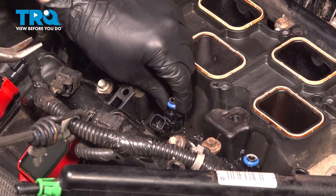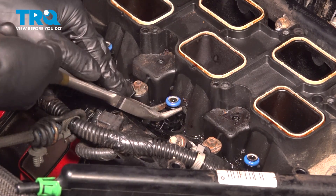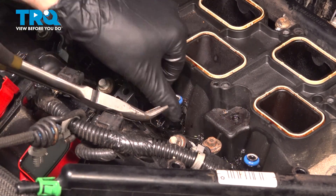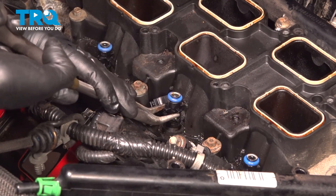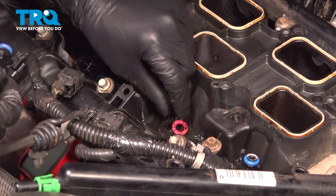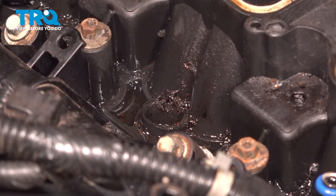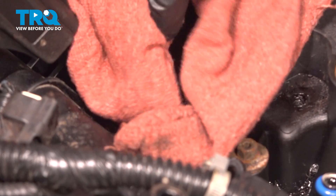Now let's replace our injector. I'm going to show you how to replace just this one injector because the procedure for all the others is exactly the same. I'm going to very gently take these needle-nose pliers and pry this straight up. There is a lot of fuel down there, and that will actually help because it will allow it to slide a little bit easier once it breaks free. Apply slow, steady pressure. My O-ring is right here and I have quite a bit of debris there — I'm going to clean that out. At this point I strongly recommend some compressed air to blow all the debris out. Do not use a vacuum to suck up fuel and any fuel-soaked debris. Put a rag over the hole so it doesn't blow everywhere.